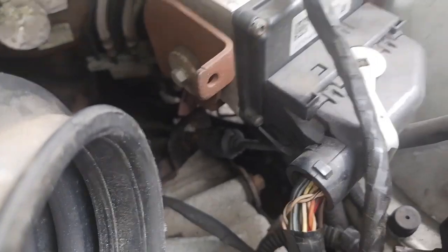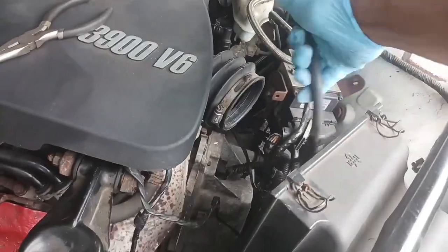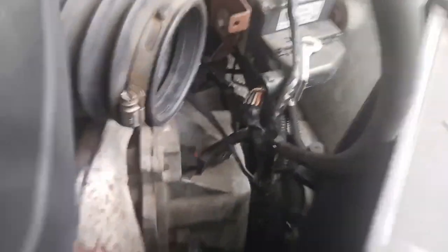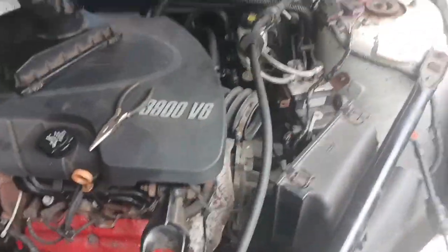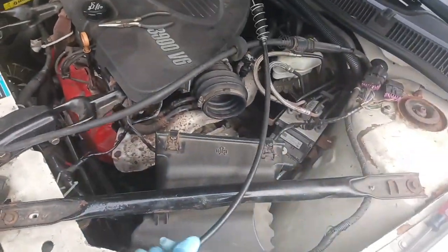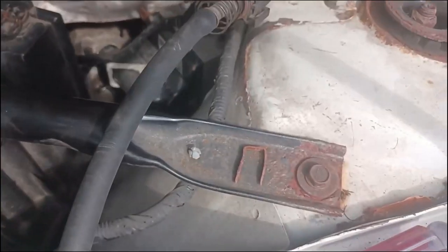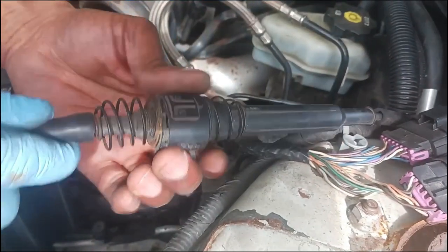The two pieces are connected — remember this is a two-piece cable. One half is connected to the transmission, the other half is to the steering column. That little arm — the little part that connects to the transmission, that little circle — you've got to maneuver it out of the hole that it sits in. This is the replacement cable. It separates right in this area, and this cable can also go bad on the steering column side, but it just so happened that this was the transmission side.